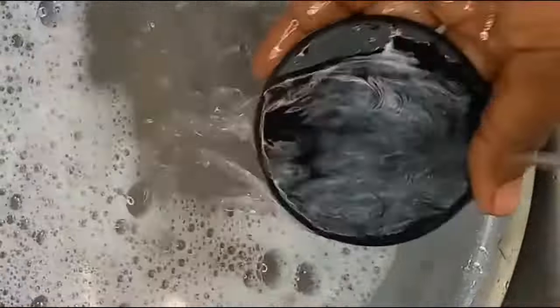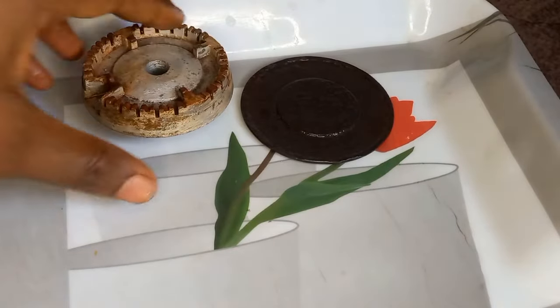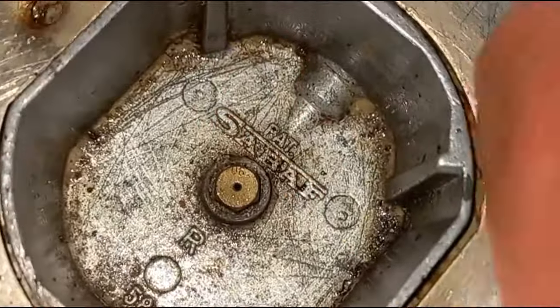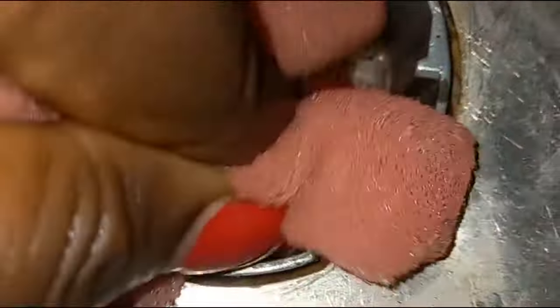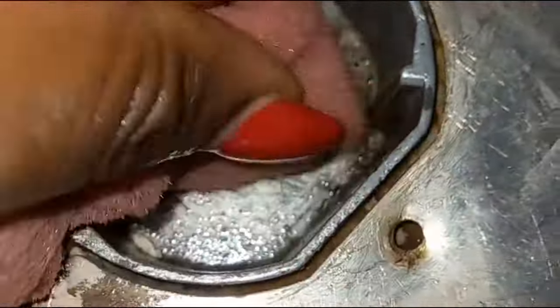Touch that place to see if it still stains your hand — that's under the flat plate. After washing, I'll rinse it and let it dry, because it's not good to wash it and put it back immediately into the panel — that encourages rusting and your gas flames will not come out well. Next, I'll use a damp towel or foam to clean up that panel and remove all the debris inside.